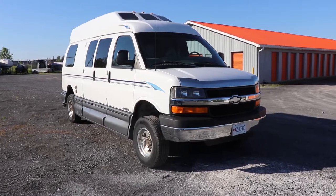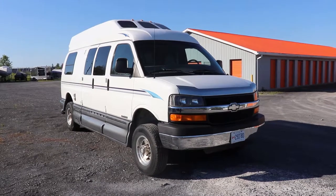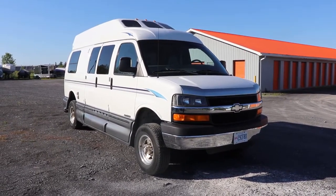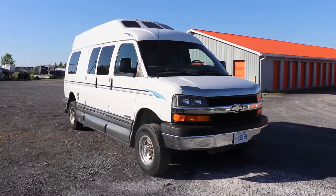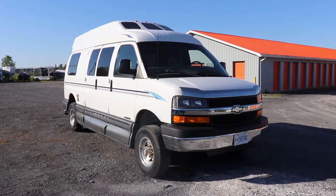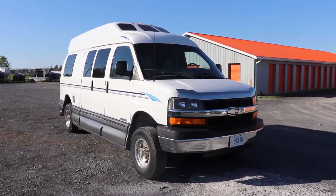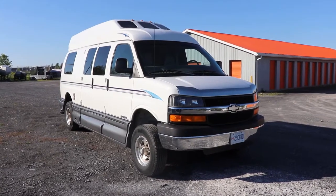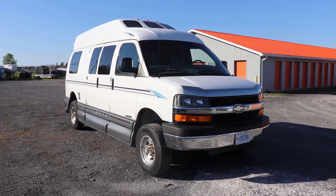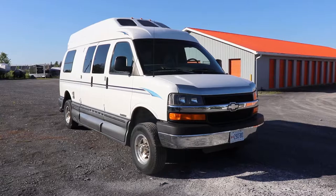Using ceramic brake pads will be good for a while, but not permanently. The ceramic brake pads do not work well on this vehicle at all — you need to have semi-metallic brake pads. These vehicles come from the factory with ceramic brake pads, and a lot of them have death wobble because of it. It doesn't get the news coverage that the Dodges get, but it's very bad on this vehicle from time to time.